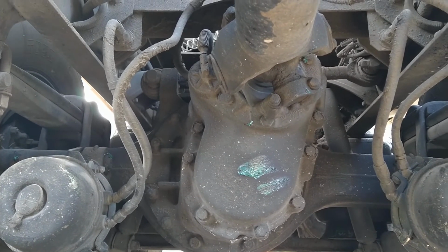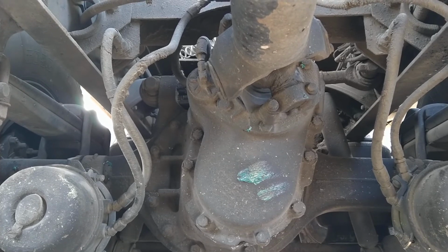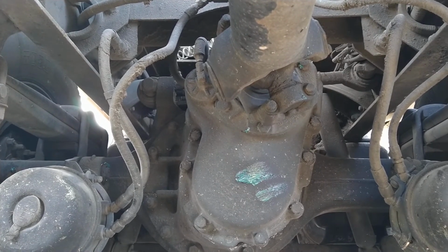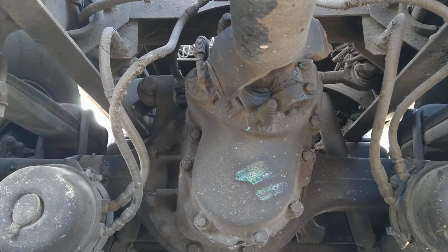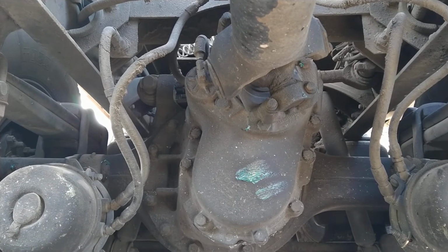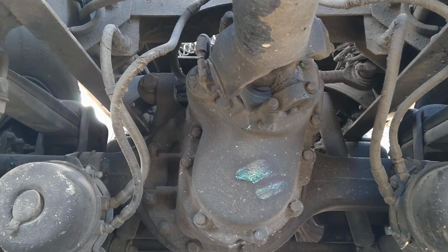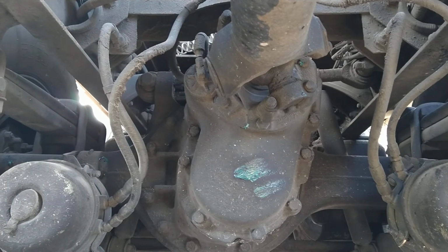Then I had to go to the rear axle, and sure enough, I couldn't get it to line up, so I had to set the brakes to extend the rod, raise it up in the air, and have the brakes released again, and let the bolt get in place, put the nut and washer and whatever, get it all tightened down the same way.